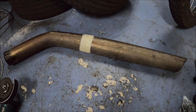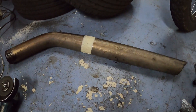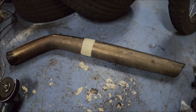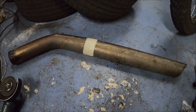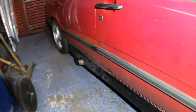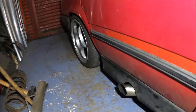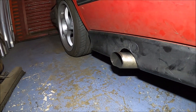The downpipe is about this long, then there's a silencer, then there's this bit — this is now three-inch straight through. I'll offer it up, make sure it's basically correct, then weld it up. It's got a lambda sensor bung in it just in case — always handy. And that's the tailpipe of the car now. It's finished, and to be fair I'd much prefer that. Looks pretty badass I think.